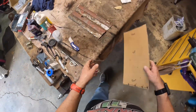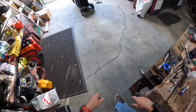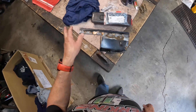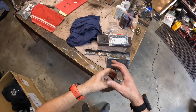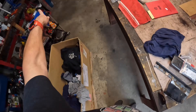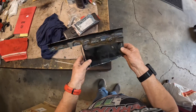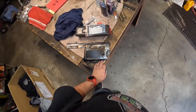I'll go up to the top shed now, because I've spent several hours getting this panel — the copy of the original — to fit in the floor. I've been practicing with my welder. Please don't judge me. I was going to use flux core, but I had to do another job on a manifold and got a quote of $180 to weld an AFR fitting into the exhaust. A bottle of argon was about $300, so I decided to buy the argon and go full MIG on the welding machine, which I bought as a retirement gift. I've been practicing with voltage and wire feed rates to try and get things right.